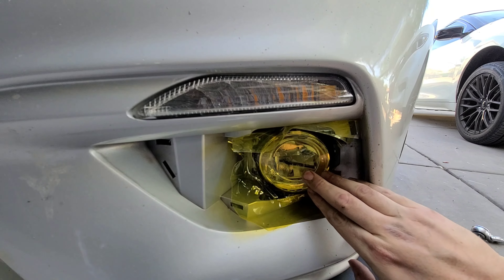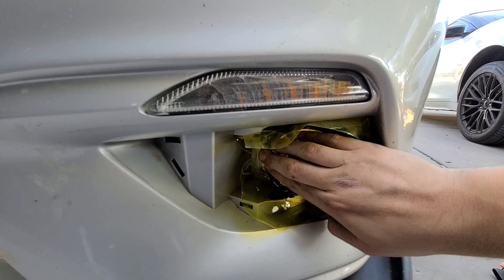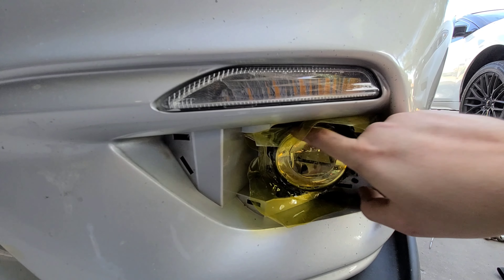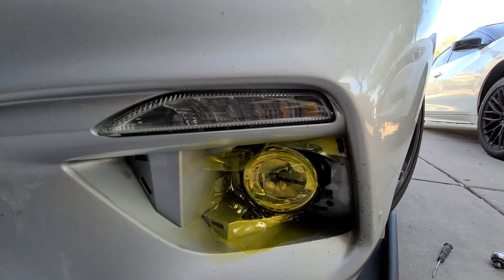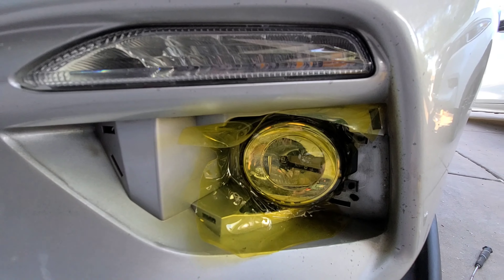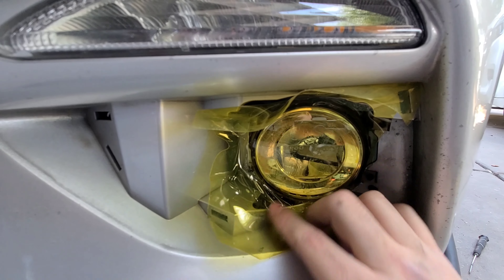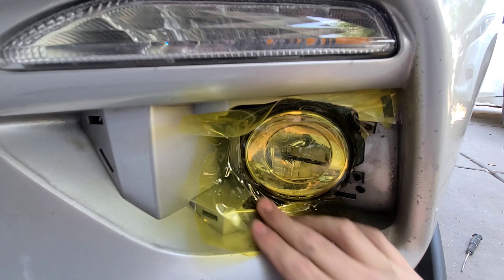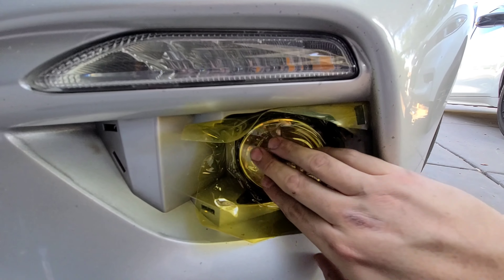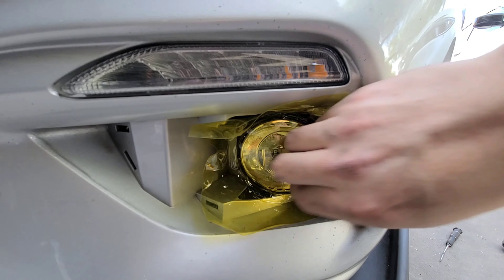What I'm doing right now is stretching out the material because you can see there are bubbles here and there. The heat gun is really going to help you out. You have to heat up the area and then take out all the bubbles, stretch it out, make sure there are no creases. It is taking me a while - to get it perfect you have to keep pulling on it. There's a crease, so I have to pull it up, pull it down, stretch it over. That way it stays perfect. It's looking pretty good - I like the yellow.